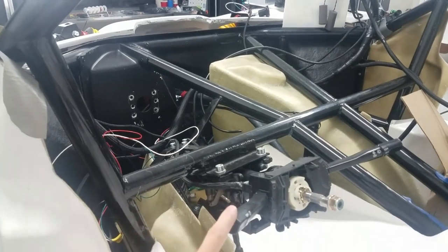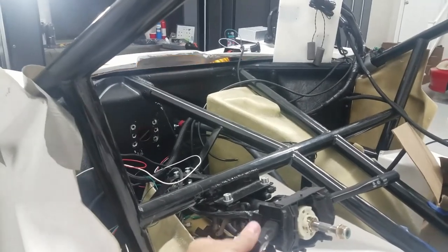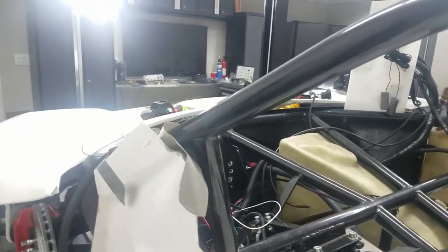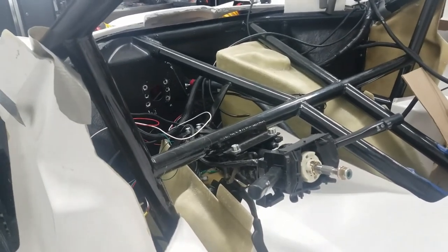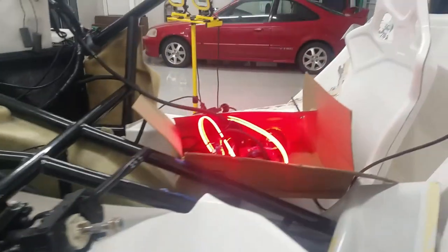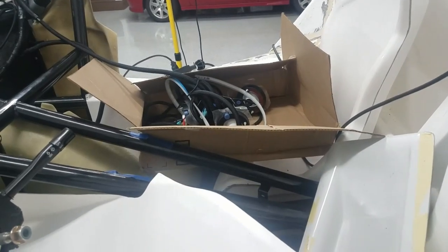All right, turn signals. Huh. So, power's going to it, but it looks like somehow we're bypassing the blinker relay. Let's check the park lights. Park lights we got. Let's test headlights. Headlights we got. Interesting, so the back came on, not with the park lights, but with the headlights.